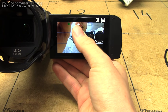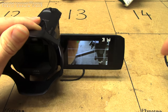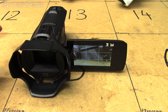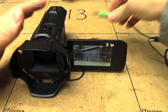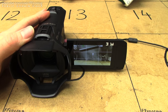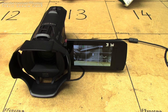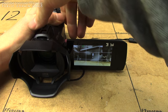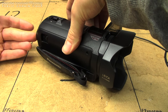It's literally just a monitor as if it was connected on HDMI. And one of the most critical issues with this is a bug concerning the microphone input. So if I were to connect something to the microphone input, you will get that — it indicates that there's been an error. And as long as that is there, you cannot do anything. I am pressing the record button, but the camera is not recording.